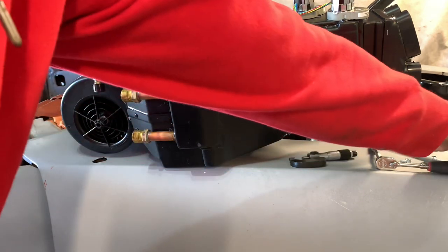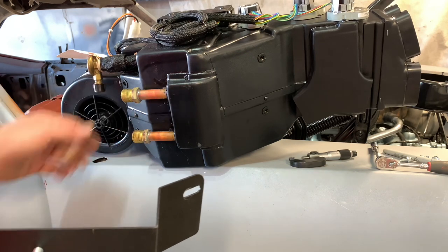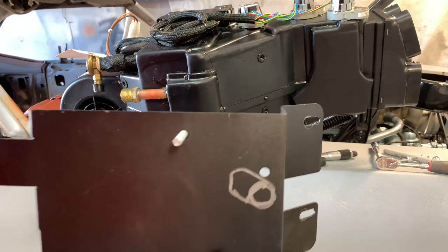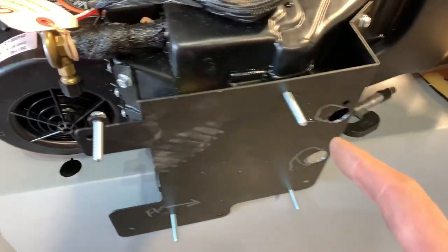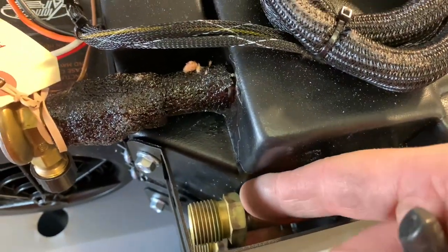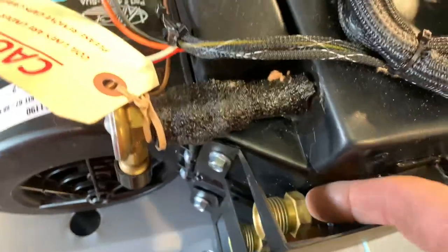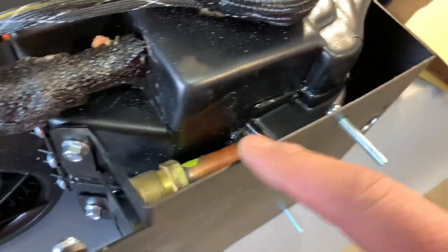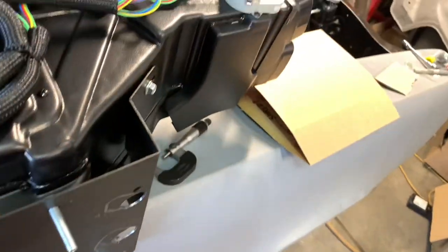We're going to ditch these included fittings — that's going to go to the scrap pile. We also have to cut these fittings off this heater core, which probably voids any warranty vintage air might have had, but that's okay. Modifications are cool. I've got the holes punched in. I'm going to come up with a parts diagram. We're going to cut that flange off. We're going to need some kind of a union — a 90 and a 90. So let me draw a little diagram.